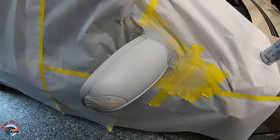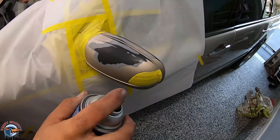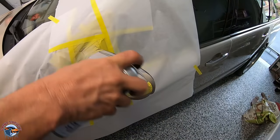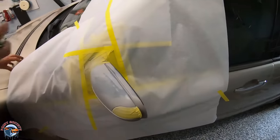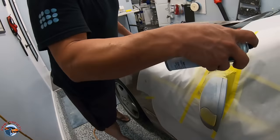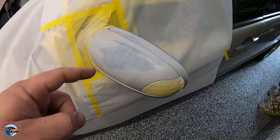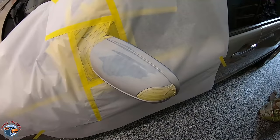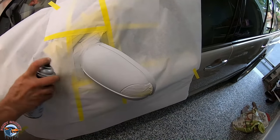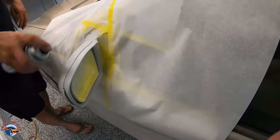On the front side of the mirror, you can see there's maybe some overspray but it doesn't need primer — it's actually still good paint underneath. Once this dries we'll hit it with 800 grit and then it's ready for base coat. On Jeremy's side — that spray pattern is a little novice but the angle is right. Same routine: first coat light, skip ahead to the third coat and go a little heavier to make sure no plastic shows through.